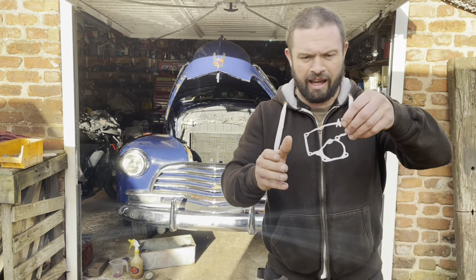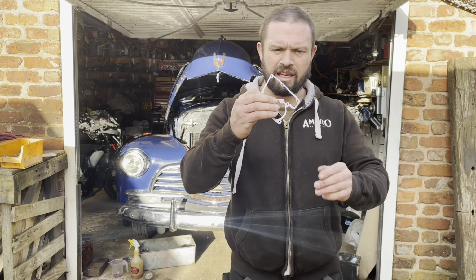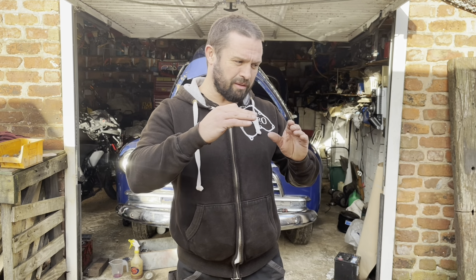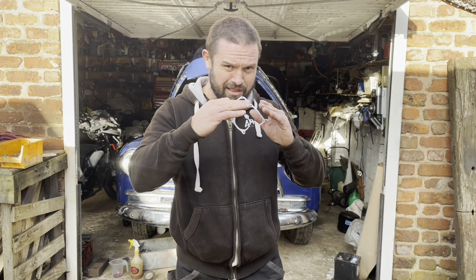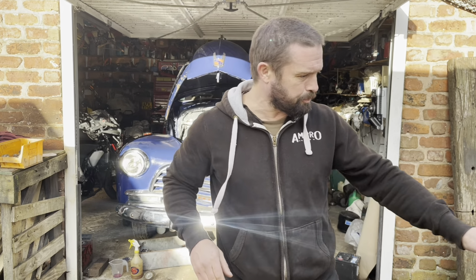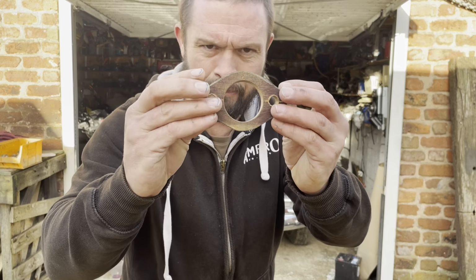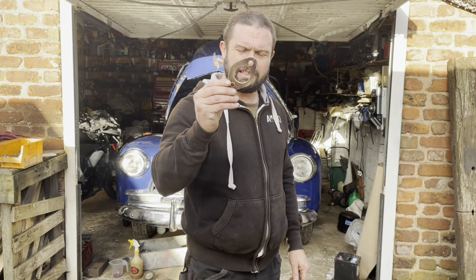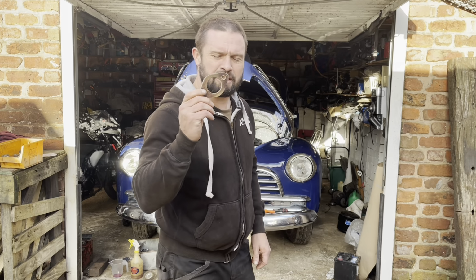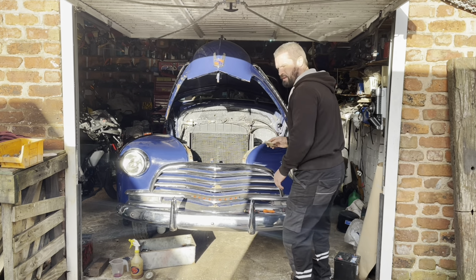And then I've copied that onto gasket paper, which I think was about 1.5 millimeters thick. I wanted a slightly thick gasket paper because the carb, it's so old, it seems to be a bit warped. So that'll take the warping out. But the only reason I'm 5 weeks late is because of this, yeah? See, look at that. That is like a heat dissipation plate, which goes on the manifold. I'll just show you.